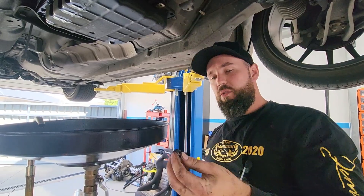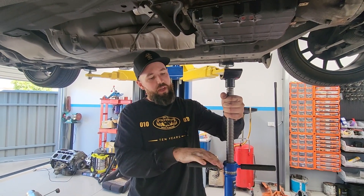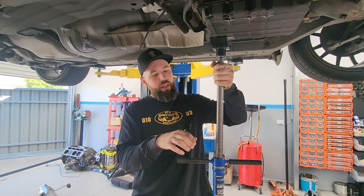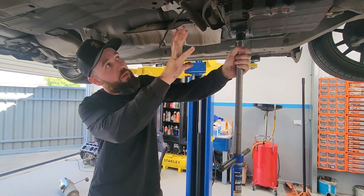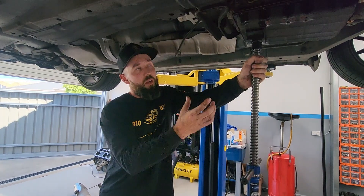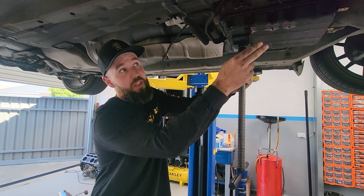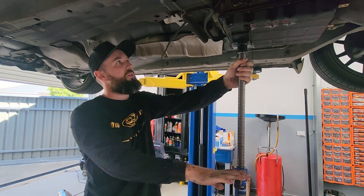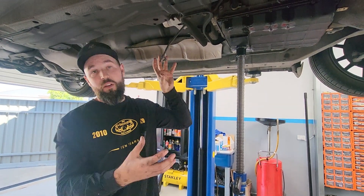Keep turning over the engine and repeat the process for the rest of the torque converter bolts. Getting the bell housing bolts off and taking a trans out can be tricky. One way to make it easier is releasing the bottom engine mounts and letting the engine tip back a little — that gives better access and allows you to get the trans out of the tunnel. First, undo the transmission mount bolts and let the back of the trans sit down a bit. Then take off the wiring, dipstick, and all the bell housing bolts including the starter motor bolts. Once those are all out, release it down and everything should pretty much fall out.